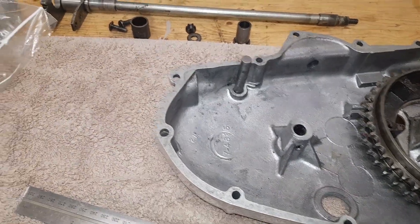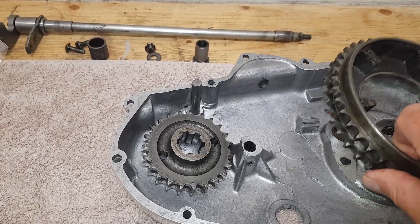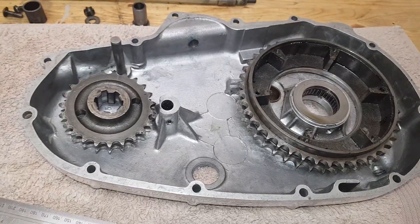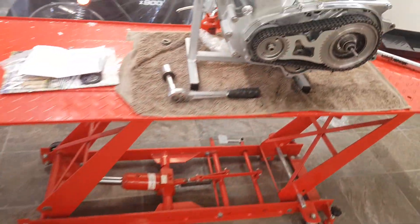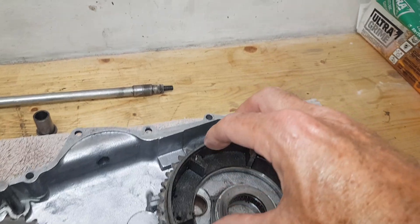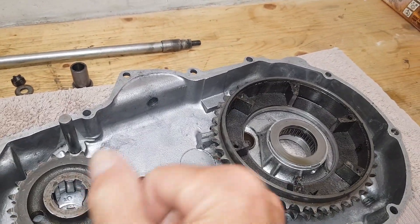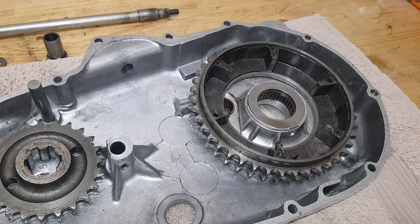What we're going to try to do is align these two sprockets. It's difficult because we don't know where this one is going to fit. So we sit this one — the center is missing because it's on the bike now — we put that one in the casing, and we're going to use this inner primary chain case edge as our datum. That's what we're going to measure to and from. If we get things lined up with that, then everything should be in line.